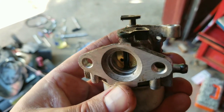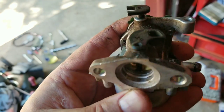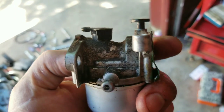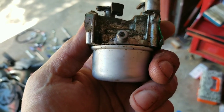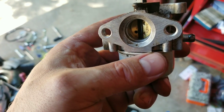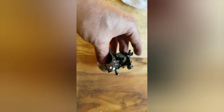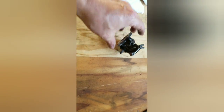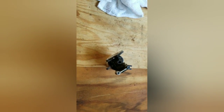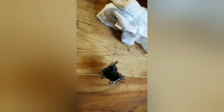When people talk about rebuilding a carburetor it doesn't mean taking it to a machine shop and having everything completely rebuilt. They're just taking it apart, cleaning it, adding new O-rings and gaskets, and cleaning out all the jets — basically making it feel like new again. Put it onto your workbench, maybe use that jar of gas as some cleaning solution, but you also want some carb cleaner, clean rags, screwdrivers, wrenches, and sockets.